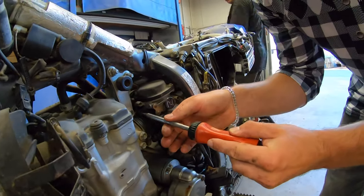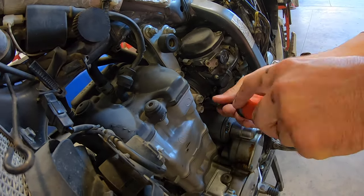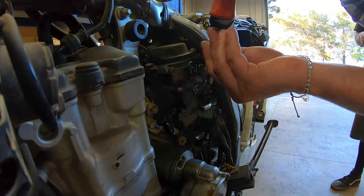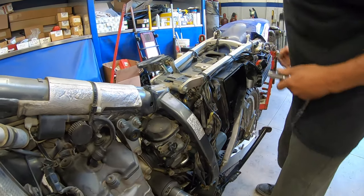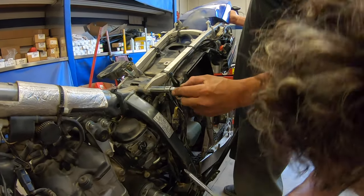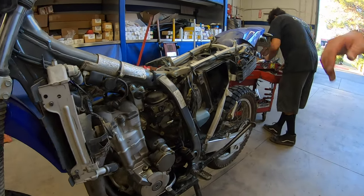You're not going to need this boot anymore, so we're just going to pull out both sides and loosen them up. This bike's actually got some nice stuff — usually these Phillips screws are nice and stripped when they're this old, but this bike has been handled by a professional mechanic. Just give it loose and we should be able to pop up the whole assembly.